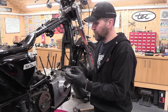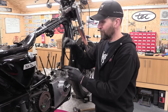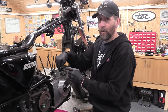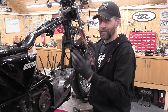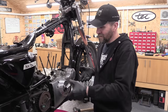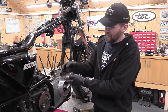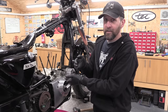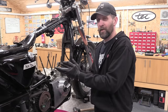And that's not difficult, but it also means that if the top end of your engine is still fully built, and one of the cams falls out, the follower will fall down inside the hole, and then you've got a lot more work to do to put it back together, taking the top off and everything else. So seriously, if all you want to do is get the cover off, make sure that when you start to take it off, the number two cam stays put and doesn't start coming off with the cover. If it does, then reach in and poke it back in place, and that will hold the others in. Hope that helps.